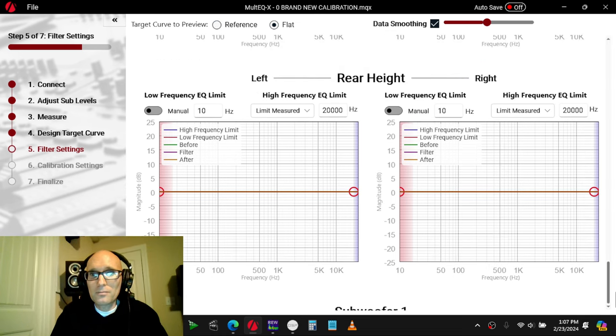I've got a lot of things plugged in here for doing this. Enhancements all off, and that's better. Two channel 24-bit 48, so again, this entire system is 24-bit 48, and we're making sure of that. You can even check on the miniDSP thing here, UMIK-2, 48, two channel 24-bit 48. This is exactly what we want. So we're in this entire ecosystem right now of 24-bit 48. We're just making sure of this. And that's all been sent. The distances are the default distances that Odyssey measured, which is fine for now, and we'll get into that later.